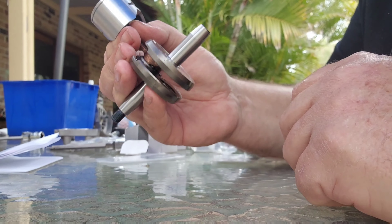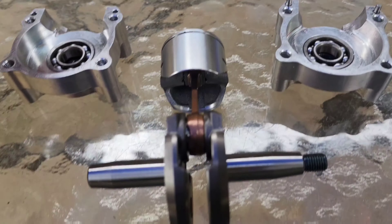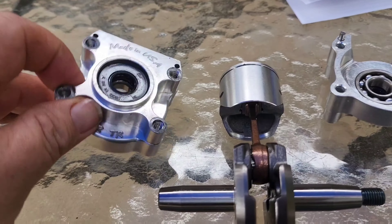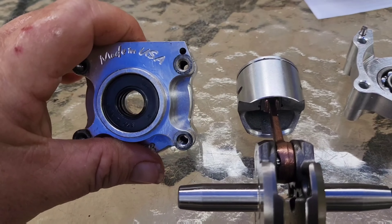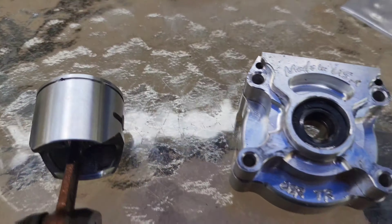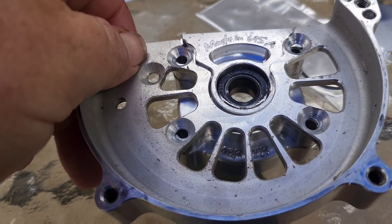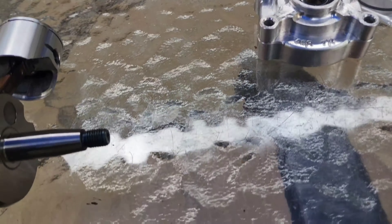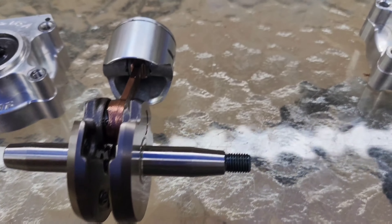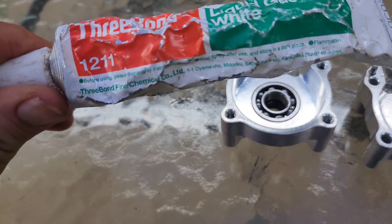Now we'll put the crank through the crankcase. You've got the crank, piston, crank cases. Pretty easy to work out with the OBR which side is which - that's obviously clutch side, and that's your flywheel side. Because that piece there goes over that like that. So there's your flywheel side with the thread. Just get a bit of two-stroke oil and rub it on each side and we'll put it together. Next up, get your three bond 1211 and just dab it around both crank cases.